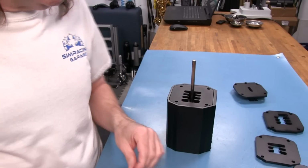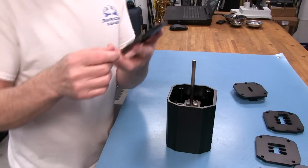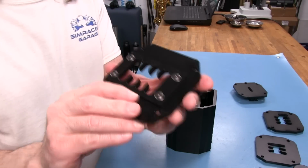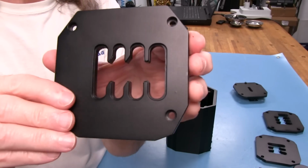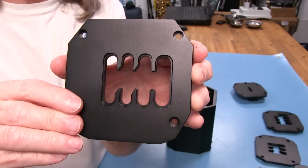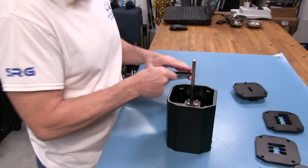Yeah, doesn't look too hot when you take it out, even though they work fine. So we'll go ahead and pull the plate off. And again, the plate's just like any other plate. We have that plastic insert that protrudes a little bit past the metal so that it's a quiet shifter, and it also helps keep the wear and tear down on our shaft.